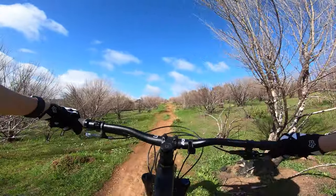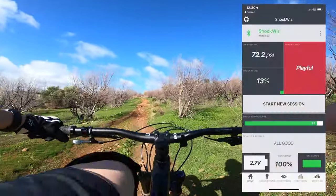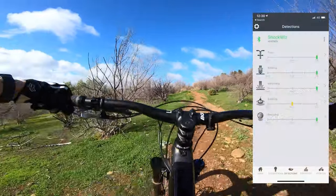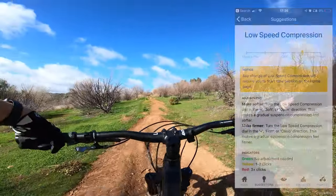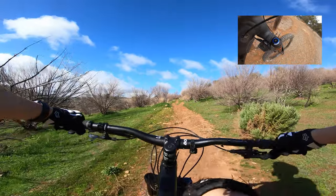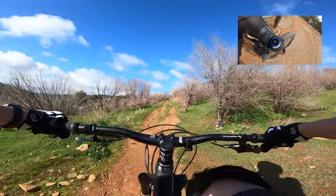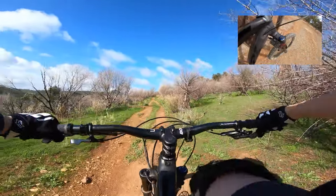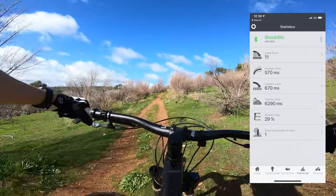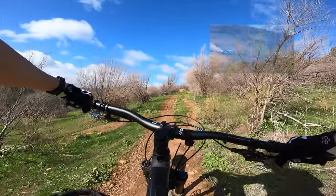We're back at the bottom of Shepherd's Hill, climbing to the top to go and hit those runs again. Still with a good playful tune — 92% tuning score, 100% confidence — and it's wanting low speed compression to be increased by one to two clicks. I've done that adjustment, and here's me tuning it up on a different ride but doing exactly the same thing. After that I've reset the tune. This is crucial. You can see a deep compression event — I felt that as the shock bottomed out on the drop on Downhill Three. Let's see if the tune makes it any different next time.